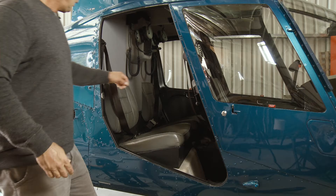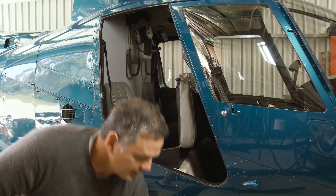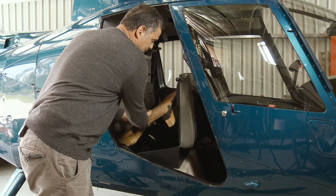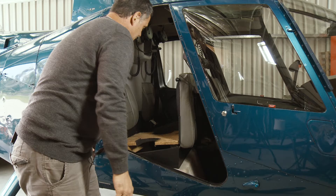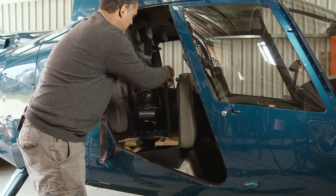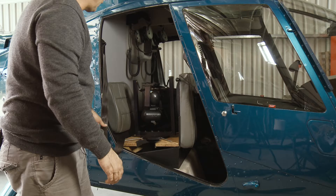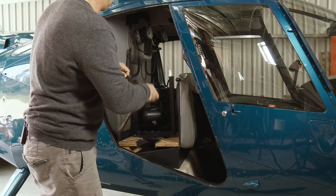To mount the gyro in a 44, we flip up the seat and just secure it to stop it from flapping about. We've built a pretty basic mount that works really well — it just slips into the open hole. The unit itself then comes up and sits on the platform, and we use position holes with cable ties and the seat belt to secure it.